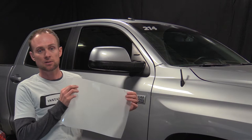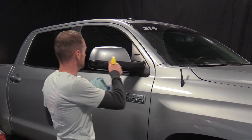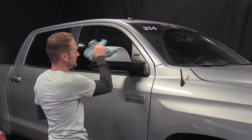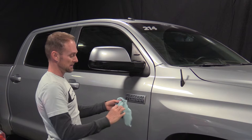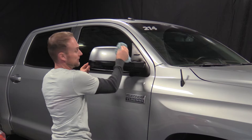One's the passenger side top, one's the driver's side bottom. The first thing you want to do is clean the surface. Get yourself a soft terry cloth — I'd recommend an alcohol and water 50/50 mixture. Go ahead and spray the painted area first; you want to get the bulk of the dirt or grime off. Rotate that towel to the other side and clean it one more time. You don't want to leave any dirt, grit, or grime on there — you don't want that behind your material.